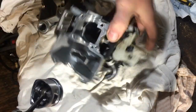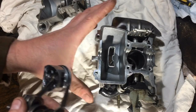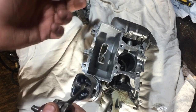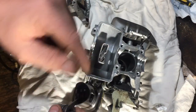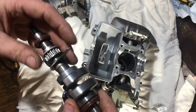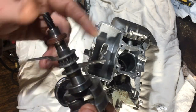Another thing — I'll show you what way the timing belt goes. Because it's got the timing belt, like the GCV engine I did, it goes through there. You have to put it around there like so first and then drop it in when you put the crank on. Once you put the crank in, you can't get the belt in after, so it has to go in beforehand.